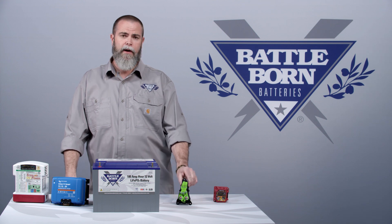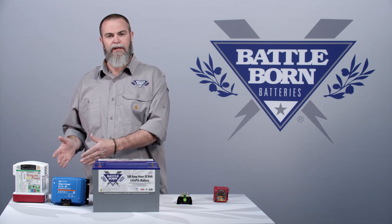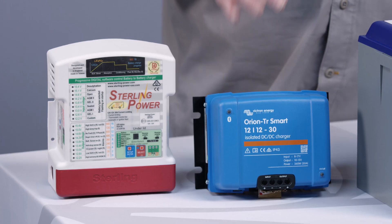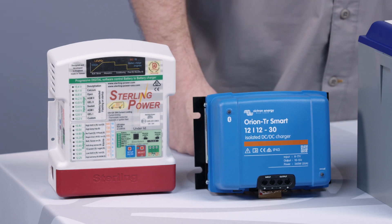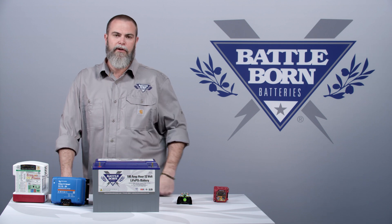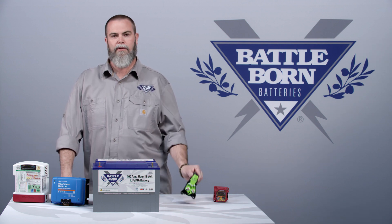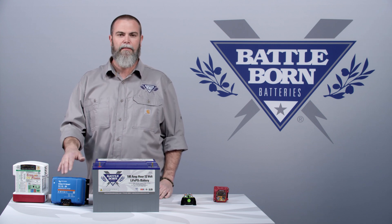We do offer this device — you can read more about it on our website. Over here, we have some battery-to-battery chargers, or what's known as DC-to-DC chargers. These basically go between your starting battery and your house battery bank. We have one here from Victron — a newer product, very popular. Redarc makes one also. Sterling is another one that we offer. These devices will actually regulate the current and not take the chance of damaging your alternator on a long drive, because they're limiting the current that comes through. The BIM can put through up to 225 amps, while these are 30 to 100 amps depending on the size. This Victron one here is a 30 amp — that's the biggest one they make right now.